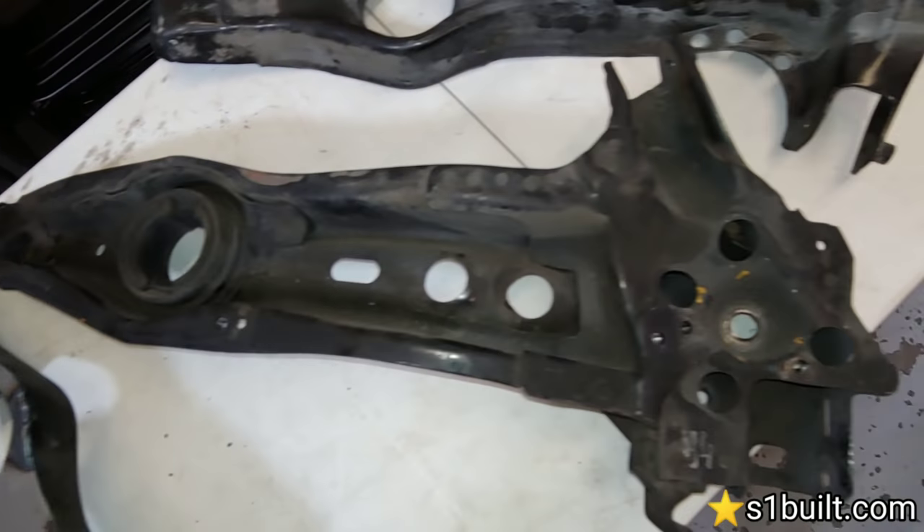Make sure this is completely welded. Next we're going to weld on the brace and grind out the back part. You can tell Jit already bent and shaped down the edges on the piece right here to make sure everything fits snug. That piece — after he welds it — is going to be ground down because the wagon CVs hit that. We'll go ahead and tack it up, just a small tack first to hold it in place, then weld the whole thing.